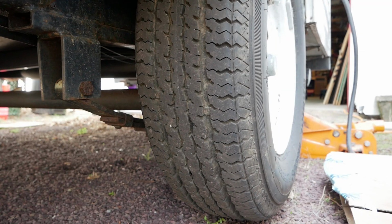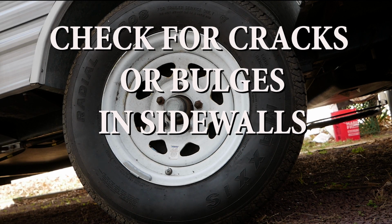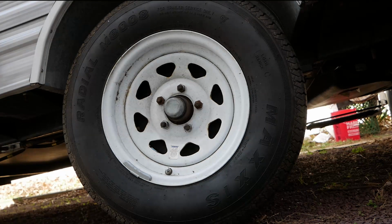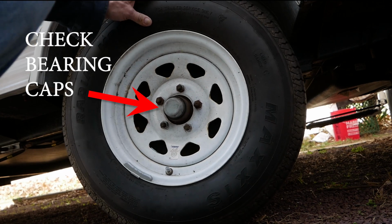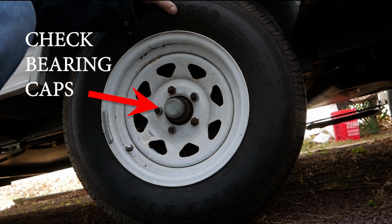So I then had my wife Kathie step on the brake while I went out to the trailer wheel and tried to turn it, and sure enough the brakes worked perfectly. I did this on both sides and they definitely worked perfectly. So you could see why I like this quick method of inspection, because you could find out a lot of information in a short amount of time and quickly diagnose any problems you might have. And then you could make a decision what you want to do next depending on your skill set, whether you want to tackle the job yourself or bring it into a shop.